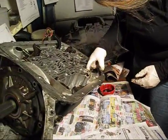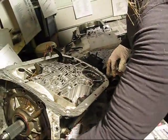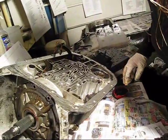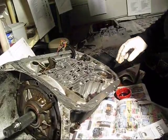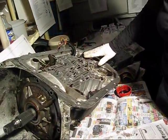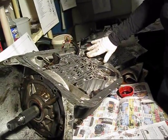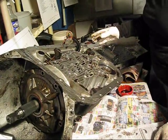There's nothing else in there. We've got to remove two retaining bolts for the parking pawl bracket, which are over here, and remove the parking pawl bracket. But do not remove the parking linkage from the case unless damaged.